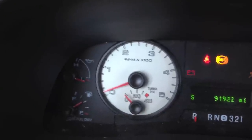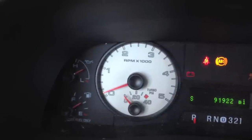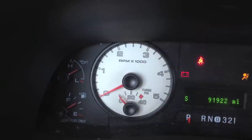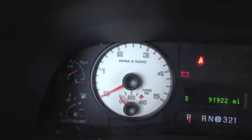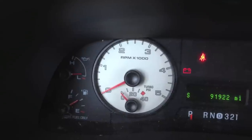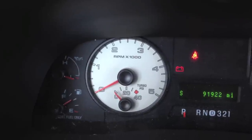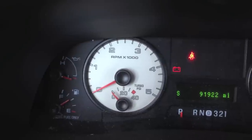Hear that clunk? There it went away and the oil pressure came up. That clunk during cranking — you get those when they don't have base oil pressure, so that can clue you in. But this one, the gauge went ahead and climbed. I'm going to assume the gauge didn't climb and show you how to check it outside, because I get a lot of emails asking how to check base oil pressure and what can cause it.